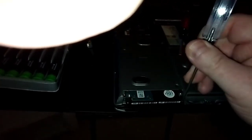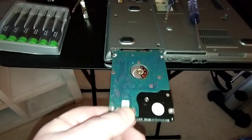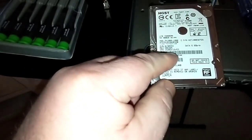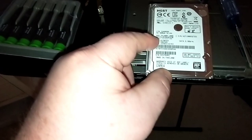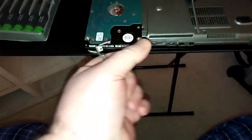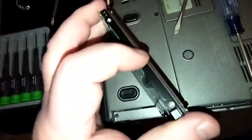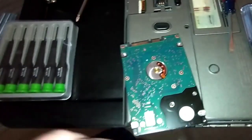You've got to put the caddy back on the new drive too. Here it comes — I'm just catching it with the screwdriver. Here's the original drive, right side up now. This is the original drive — I can't see the date on here but it's a 7200 spin speed, one terabyte. It's actually a newer drive. You'll see screw holes on the sides of it — one on each side.